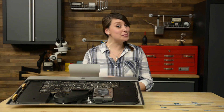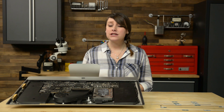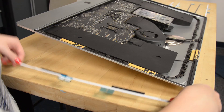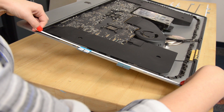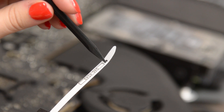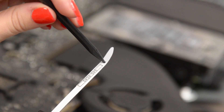Now it's time to replace those strips. Remember to take your time and be very careful — the adhesive is very sticky and you don't want to misalign it. Start with lucky number 13, which goes on the right vertical side. Before peeling off any backing, line it up against the frame of the iMac to get an idea of where it goes. Then peel the short piece of backing off the back of the strip and insert the tip of the spudger into the hole at the top of the strip from the side that has backing on it.